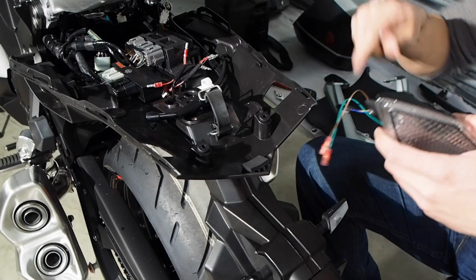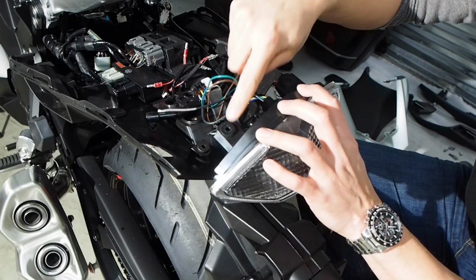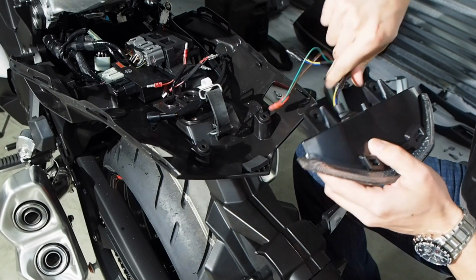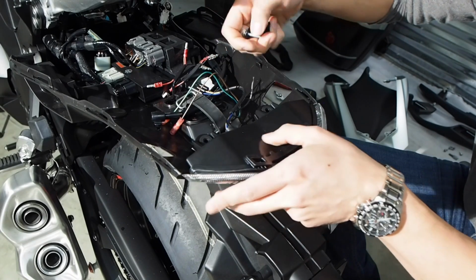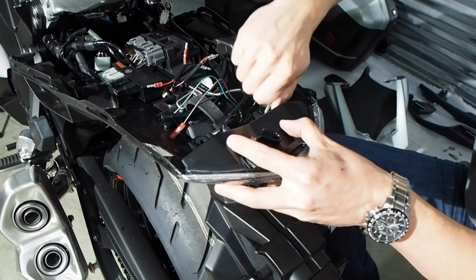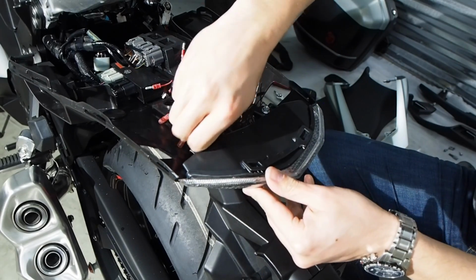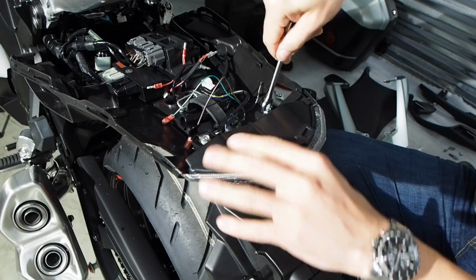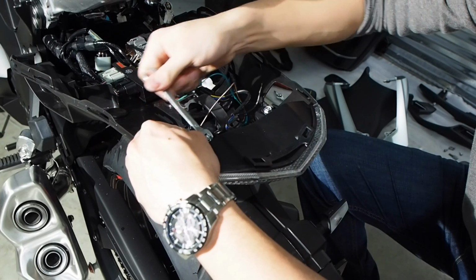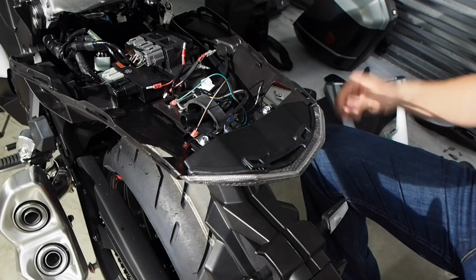To reattach the rear taillight, make sure you have the metal washers that are on the bottom of the rubber grommets on the taillight. Those go onto these 2 well nuts, and then you'll reattach it with these 8mm bolts. The bolt with the metal hook on it goes on the left side. And make sure this rubber damper is in place on the top of the taillight.